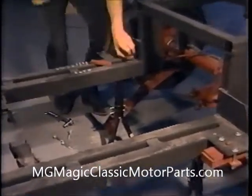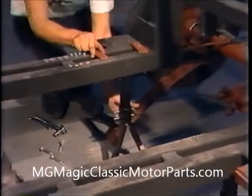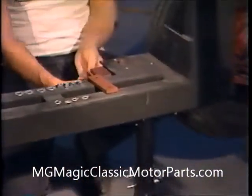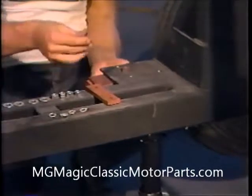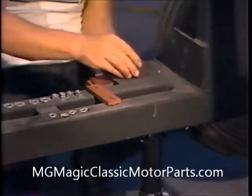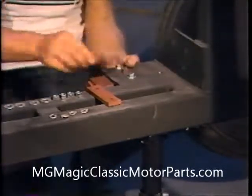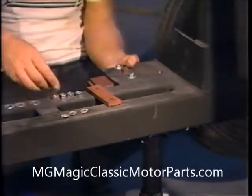After we've installed the original tires, we place our floor jack under the differential at the center of the axle assembly and position it under our new frame. We place the center anchor nut on each side into the center holes, located in the frame mounting plates. 3/8" diameter by 2.5" long grade 5 bolts with lock washers, flat washers, and nuts are used to secure the spring retainers we position under the spring. The correct tools are used to tighten the bolts.